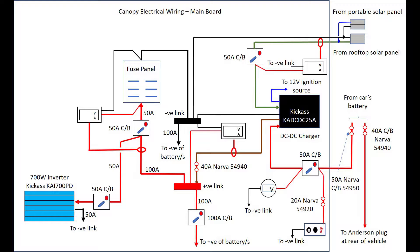As long as you know what you're doing and where things are going, it makes it so much easier to wire up and install. The other thing I needed to determine was current draw — very important to get your cable sizing right, very important to get your lugs crimped correctly. There's a big debate over soldering versus crimping; I crimped all of mine and did solder some of the heavier ones.